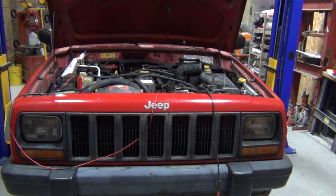It works the same as a camshaft sensor. It's inside the distributor, and I'm going to show you the test on this. The one that was bad had high resistance, and the other one had none whatsoever. I'll show you.